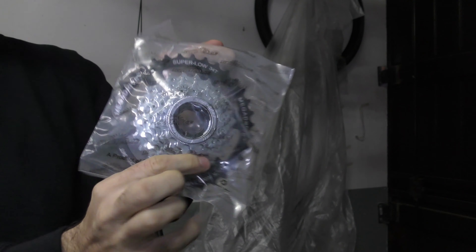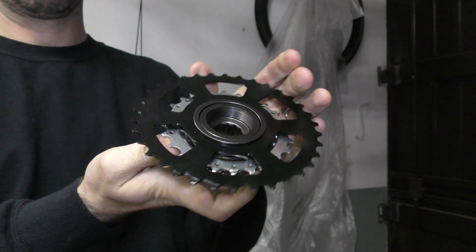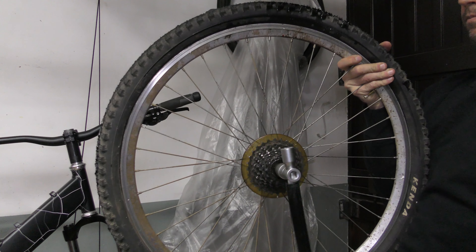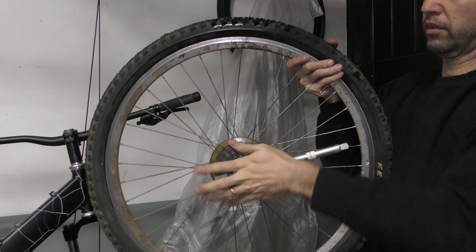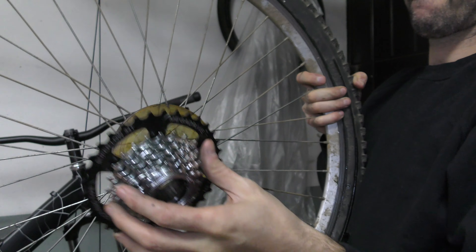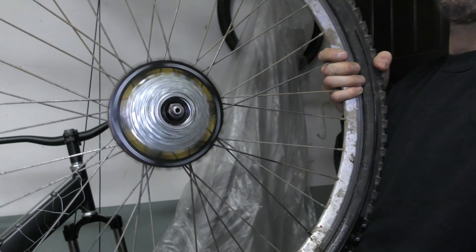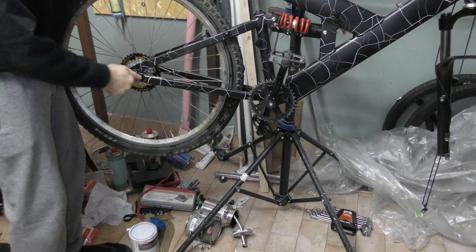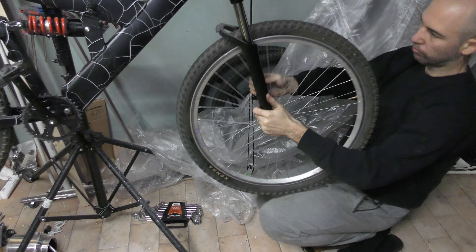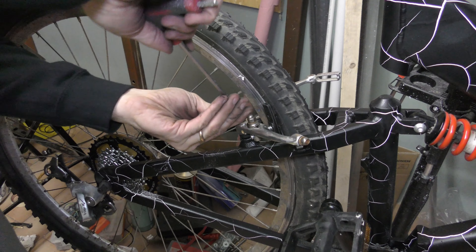...and the handlebar with brakes and everything needed. I changed the rear sprocket set with an 11-tooth and 34-tooth cassette, which is the maximum for the freewheel — and this bike uses a freewheel wheel.